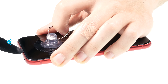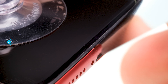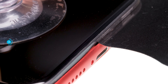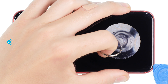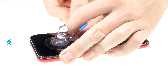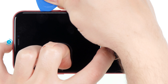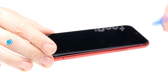If you can't get a plectrum into the gap between the display and the frame, you can use a thinner tool like the iFlex. But be careful not to scratch the frame nor go too far into the device with the tool. Also, when working with the plectrum, be careful not to insert it too far into the device. Be especially careful on the right side, where the display connection cables are located. Heat the edge repeatedly and gradually loosen the display adhesive.